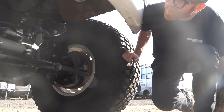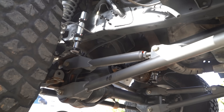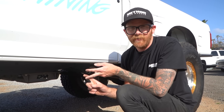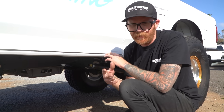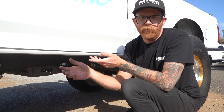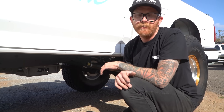I can show you right here — this is the main tube that drives down and through, and then the upper arm attaches to that in the middle. That way you can retain the factory bushings in the axle without spending two days cutting and grinding the axle off. It definitely adds to the ease of install, and it does limit flex and travel a bit. But we're kind of just more here to have fun than trying to make big travel numbers and big flex. The rear is a Sterling 10.5 — or 10.25 — literally pulled directly out of the trucks. So there's a little tech tip for you.